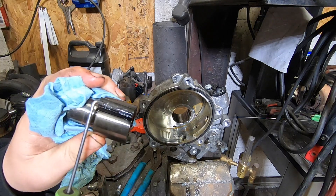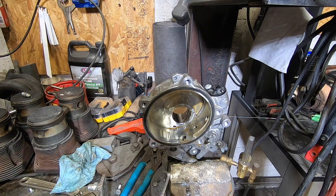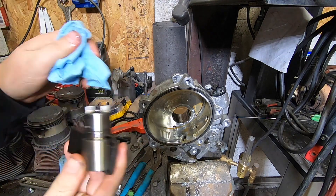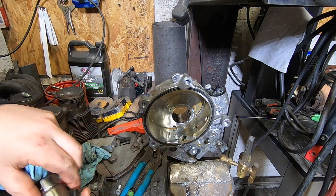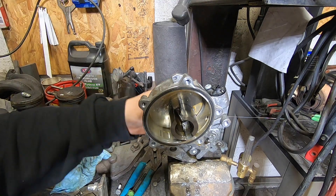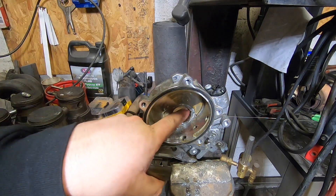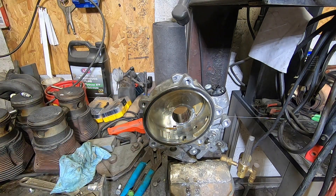When these wafers and seals come around the outside, the oil lubricates them but also helps seal them. There's an oil port right inside this bore that's critical because you have no bearing here — just this steel rotor turning inside of an aluminum housing. That rides in the back of the camshaft and gets first oil. Because this whole chamber is under vacuum, it pulls the oil down this little channel right here, lubricating the entire thing.